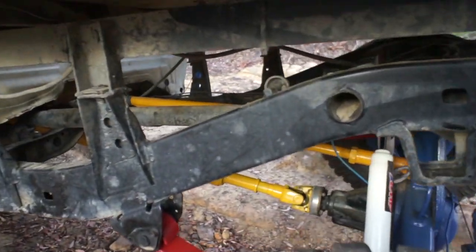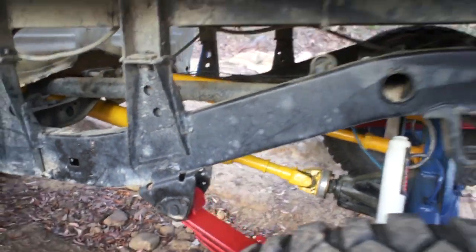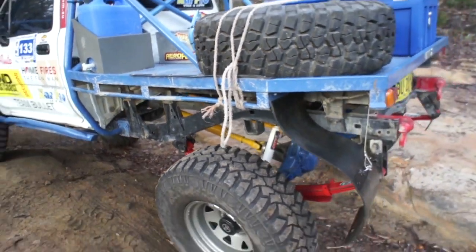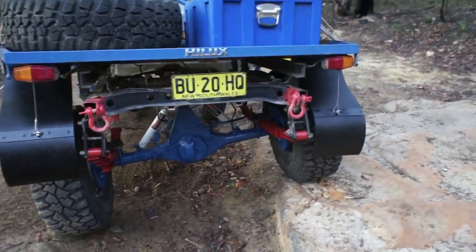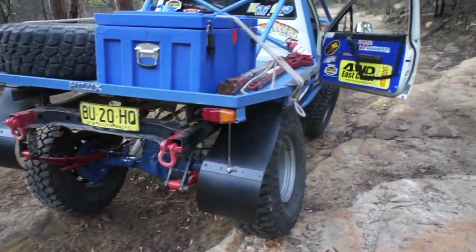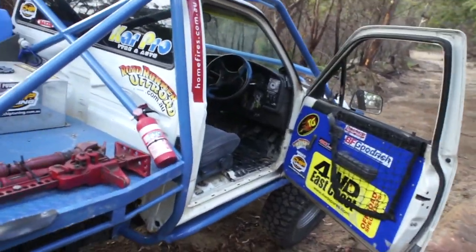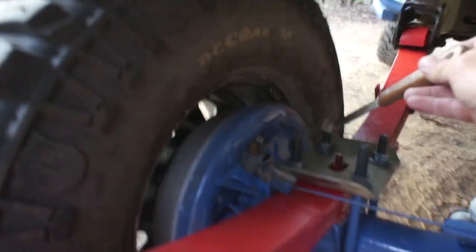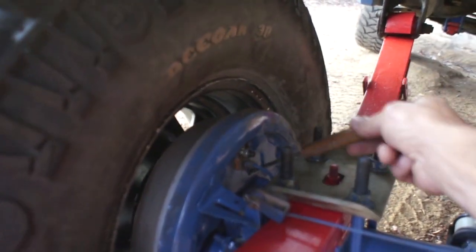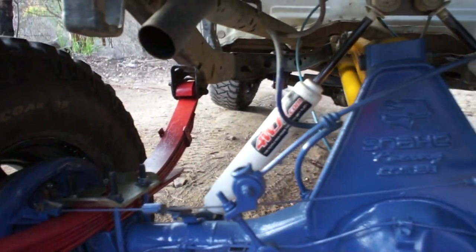We've got the new ladder bar in there, it's the old ladder bar modified, and we'll just see how we go today. One thing I noticed on the highway is I've just got to adjust the brakes quickly. We bled them before I left. So we'll air down now, and I'll quickly adjust the brakes. I've had to modify a putty knife, because with the flip plates you can't actually get a screwdriver in there to hit the adjuster. So I'm interested to see how she goes today.